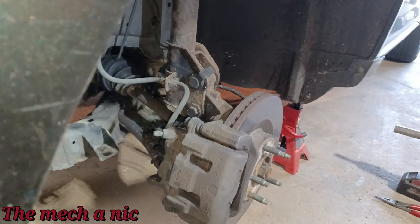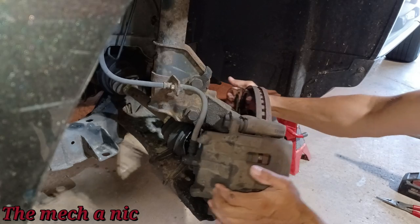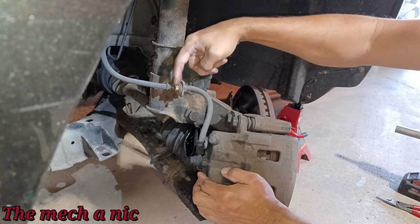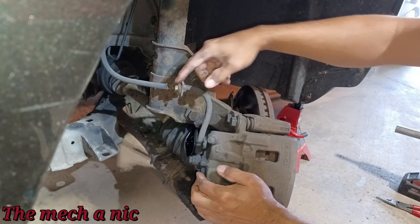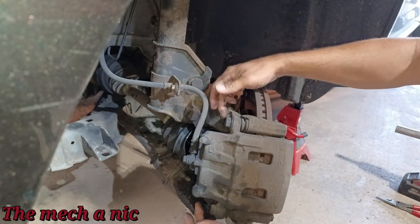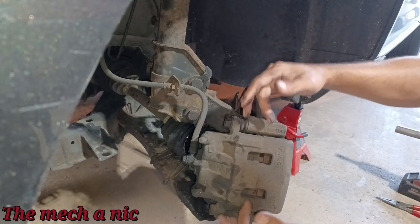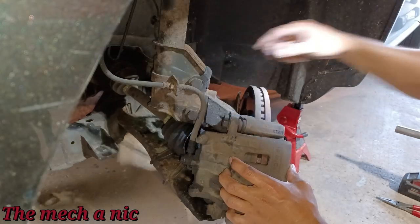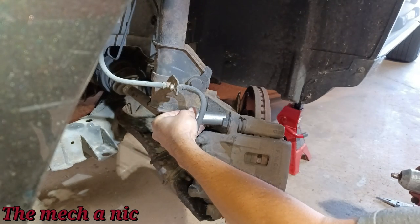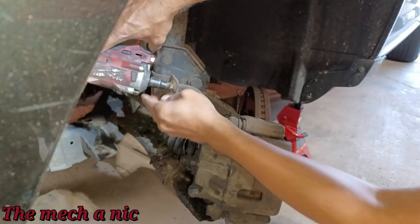The reason I like to start with the outer tie rod is that now we have free motion — we can turn the knuckle any way we need. Next I want to take off this 10mm bolt, then remove the caliper bracket from the knuckle. I'm not going to mess with the two bolts connecting the caliper to the bracket. These look like 19mm again — yes, right on the money. Using the stubby 3/8 impact.